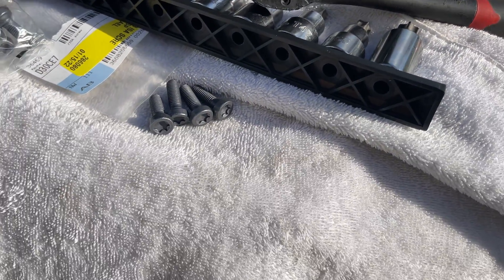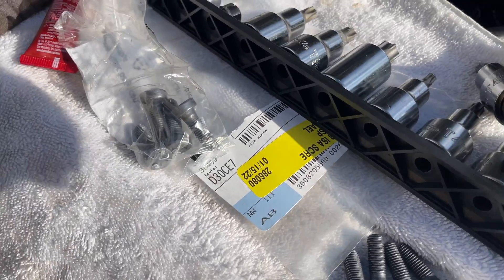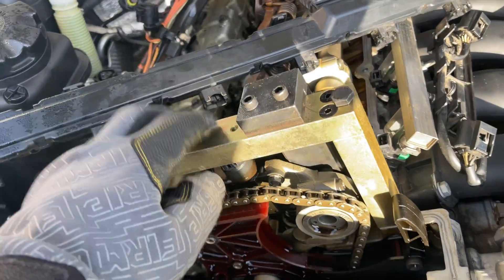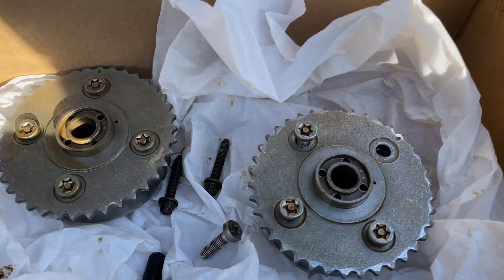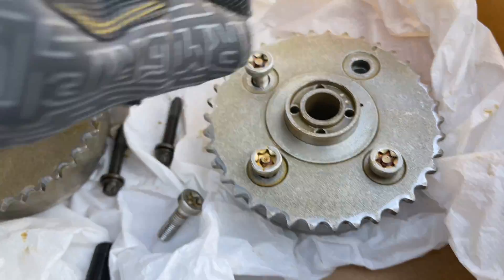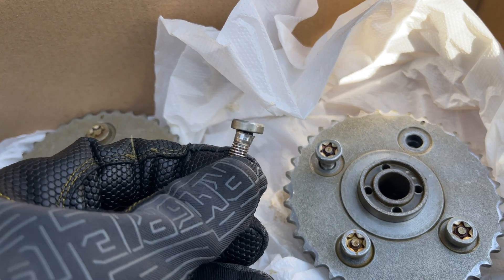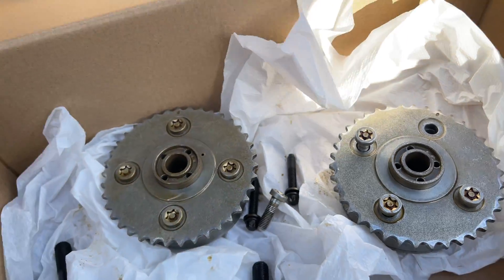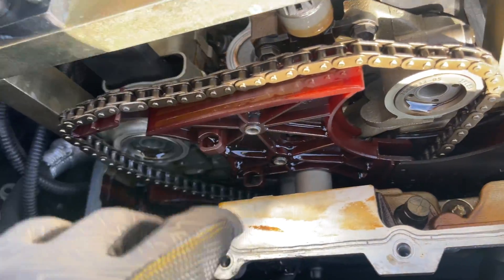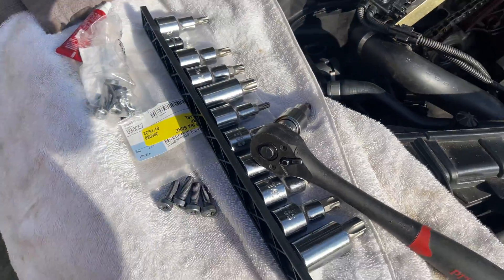When I turned the video camera back on, here are the new revised bolts - see how fast that was? So I've got the vanos actuators out, my special tool has the cams locked, and there are the actuators. It turns out none of the bolts were actually sheared - three of them were backed out and one was still in. This was the worst of them. I got really super lucky - I caught this in time. Maybe a couple more days of driving and those bolts would have backed out more, eventually sheared off, and made their way down to the oil pan.